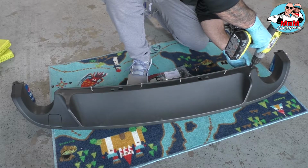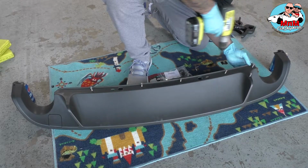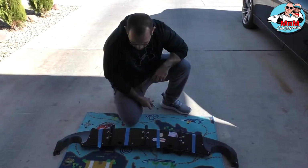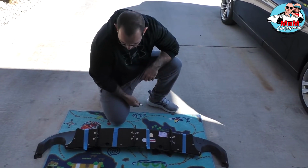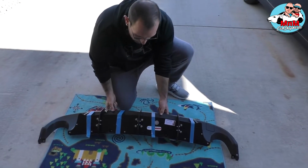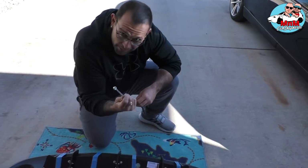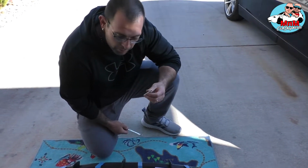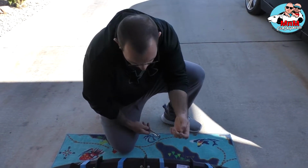Make sure you hold the plastic so it won't move. Now we're gonna take out the bolts and put in the diffuser, the extra piece. Okay, now we made the holes, we drilled the nuts, the bolts, and let me show you. You have to use an 8mm ratchet, a wrench, and an 8mm extension. I'm sorry, before I said 5/32, it's an 8mm.